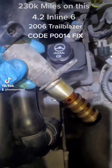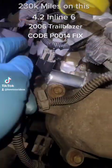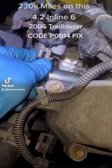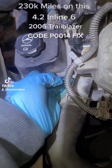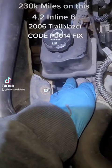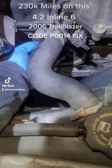This one is also a 10 millimeter socket — one bolt right there. You unplug the connector, but since there's not enough room and this part is pretty long, you have to remove the power steering pump and the pulley.